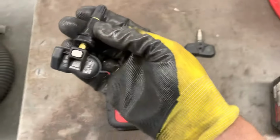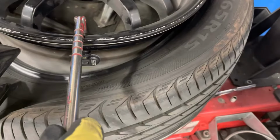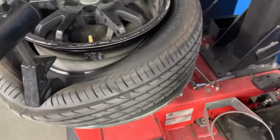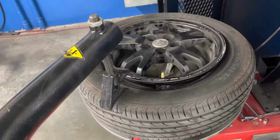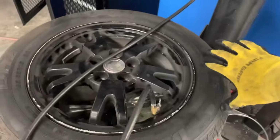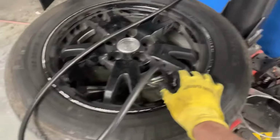All right, so let's pop this new guy in the tire over there. Tire back on the car, air in the tire, and we're done. Let's get it straight. Good. Just pull it in there. Just release this guy. And I did not remove this tire, or I didn't clock the tire on the rim, so I'm not going to bother rebalancing it. It's fine in that respect.